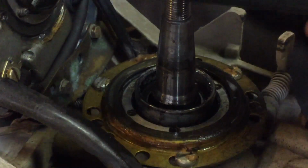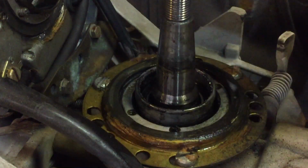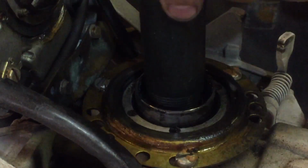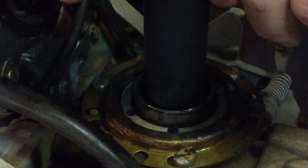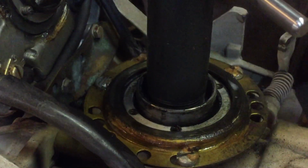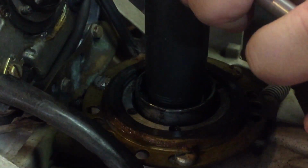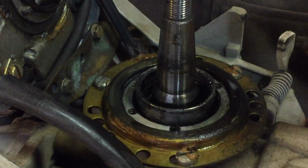So there's a specialty tool for this. This is by Richard's Outboard Tools. I'll leave a link in the description of where to get it. But it makes it super simple. Just put it on, thread the tool down into the seal until it doesn't want to turn anymore. And then you tighten the screw on the top, and it pulls the seal out.